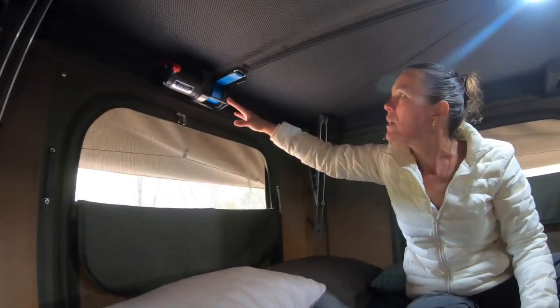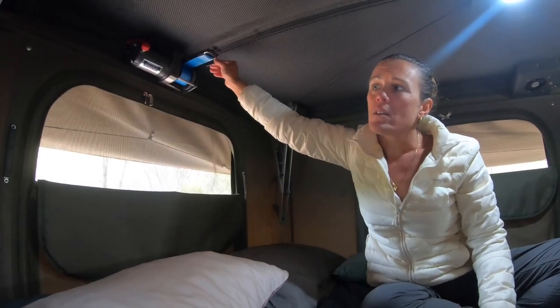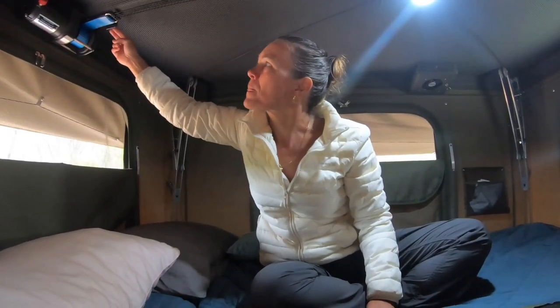In terms of what issues have we had, apart from that strap going on us, which was a fairly big issue, but easily fixed, we did have a little issue with the limiting switch on this tent, and in fact on the other one as well. So the tent comes with limiting switches for the up and the down. This one that sits up here next to the winch motor is actually the down limiting switch, which obviously stops the tent at a certain point. Now, the problem we had was the tent wasn't closing. It was stopping too early, and then we had to constantly fight with that limiting switch. So we decided to override it. It was a simple matter of taking the switch out, connecting the wires so that you've got a circuit. Not a problem since. Obviously, when you're putting the tent down, you take your finger off the button, the tent stops going down. It's a bit of a no-brainer.